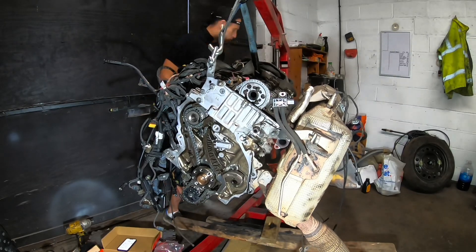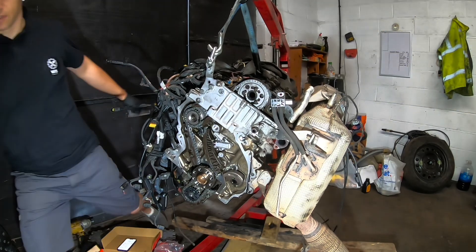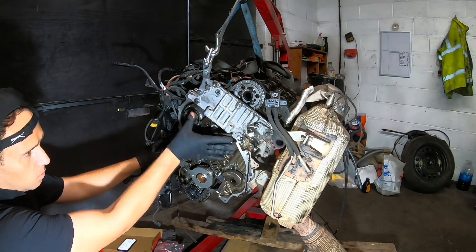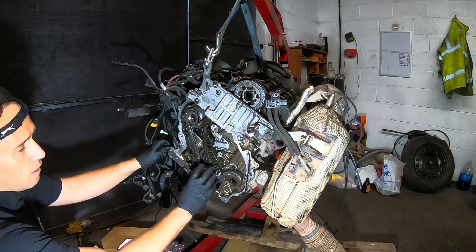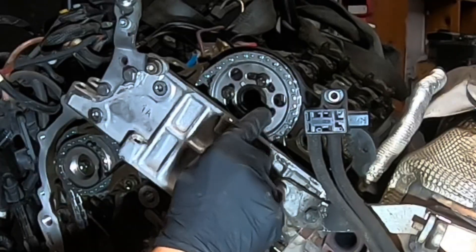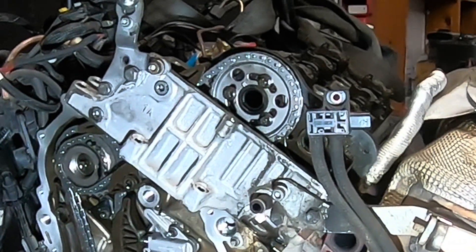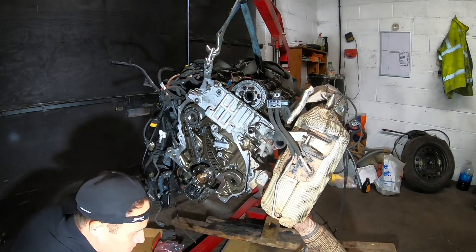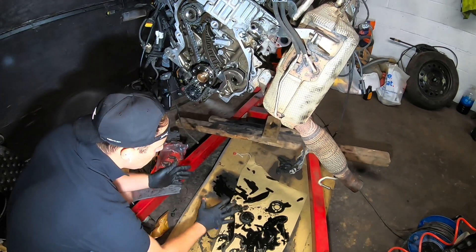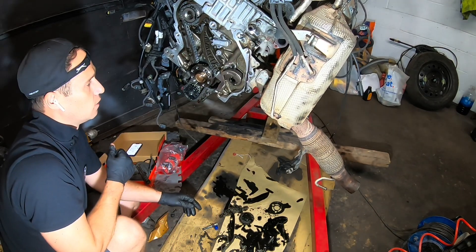This should be the one. My marking is spot on. But like I said, the last accurate adjustment will be with the cover on, the flywheel bolts back, and then I can put the locking tool — and I still have margin to play with here. I'm happy at the moment. Let's clean up this mess — the old timing chain. Everything new out here. Let's clean this mess and then start the timing cover.